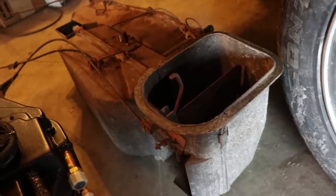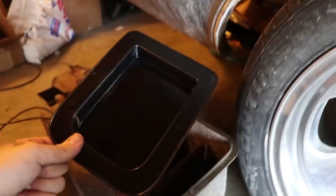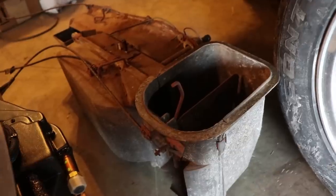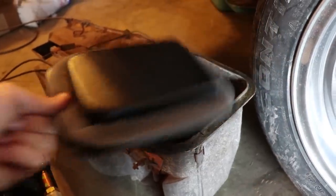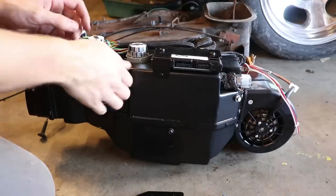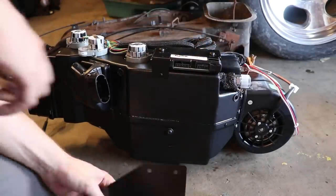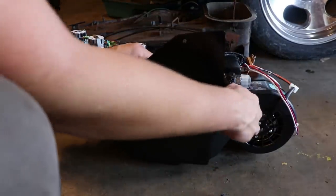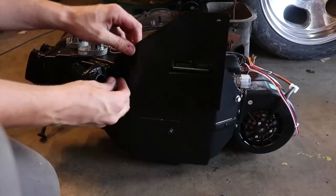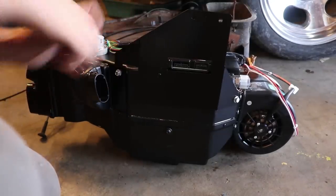I mentioned this fresh air door right here, and Vintage Air actually caps this off. Here is the cap we'll be using. Basically, the hole that's in the firewall — we'll just mount directly this way, screw it in, simple as it gets. The instructions are telling me to take out these two bolts right here and then add this mounting bracket in its place. Pretty simple — bolts were already in there. We'll tighten these two up and we're good to go.